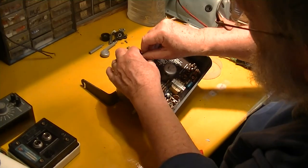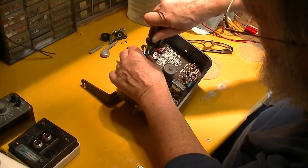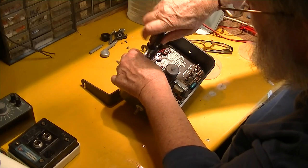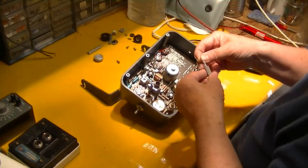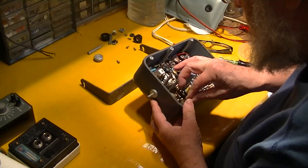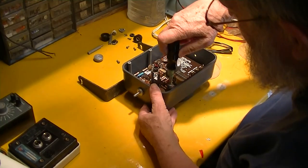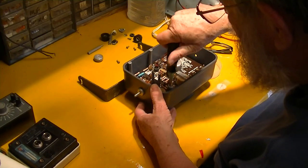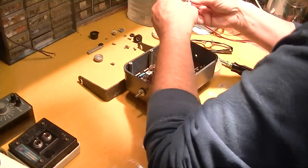This is the process — seems to be a little hard to get these started into the threaded plastic. You want to be careful and not strip the plastic out, because you really only get one chance with that. With the nut driver I can't really get my fingers in there to hold the stud straight.